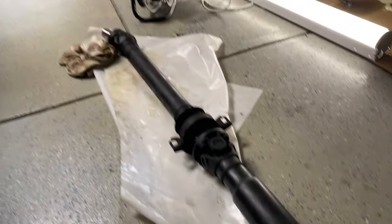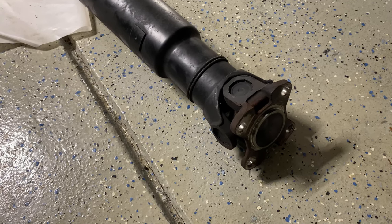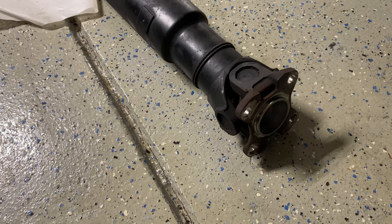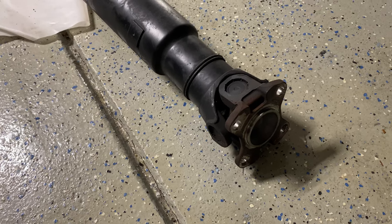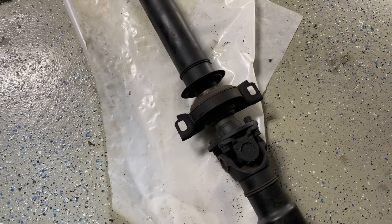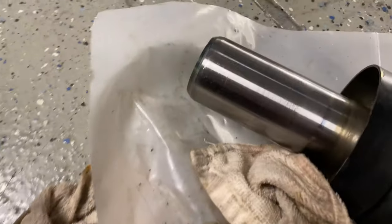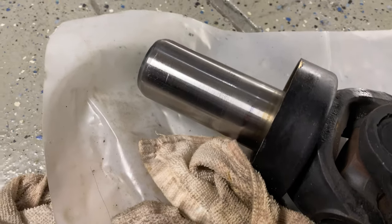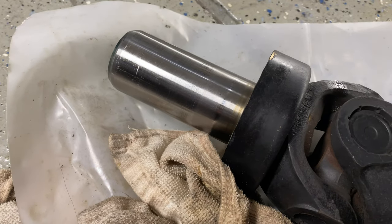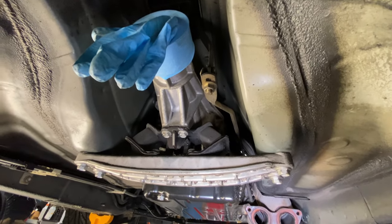I got the drive shaft out, just pulled it from under the car. These end bolts weren't as bad as some people think, but I was using an impact. When doing it by hand they're on pretty tight — pretty fine threads, and those center bolts were long, so it took a while. Once you get all that out, everything just slides right out. You can see the shaft up here seals with the oil seal into the transmission — that thing is leaking right now. I'm going to put a glove on the end of that to act like a little condom to keep the fluid inside.